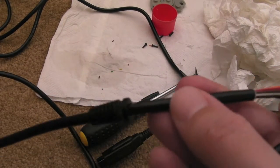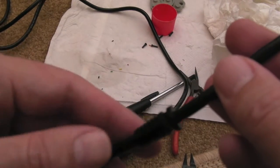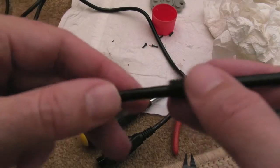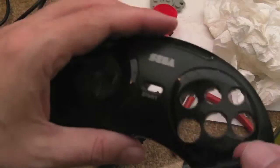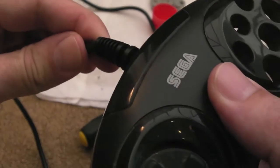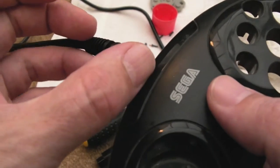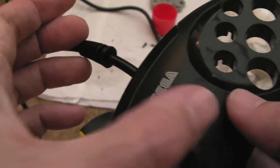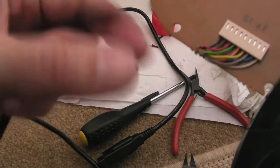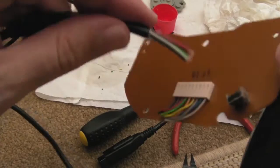This is the way I do these sorts of repairs. When you've got a cable that's intermittent — not working right, sometimes works, sometimes doesn't — assuming you've cleaned the connectors and buttons up, then typically it's going to be a bit of damaged cable. The damage points on these things are typically at the point of entry to the controller itself, around this sort of position. You might find that bending it suddenly starts working, bend it another way and it doesn't — that's an indication the damage is somewhere around there. In that case, you would chop off an inch or two of cable, reuse the grommet, and re-solder the wires straight onto the board. You could also join them up with heat shrink tubing, but you need pretty thin heat shrink and I've got none sufficient, so it's easier in my case to solder them straight to the board.